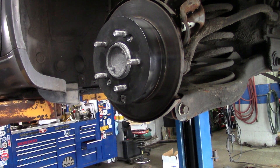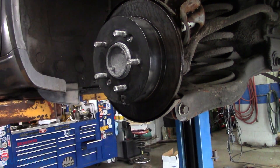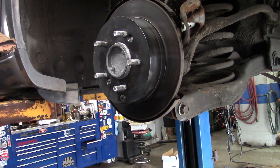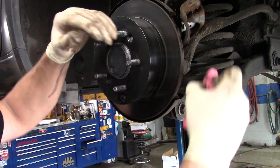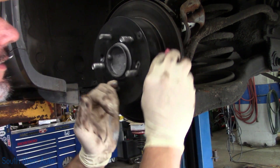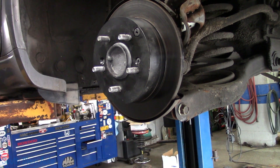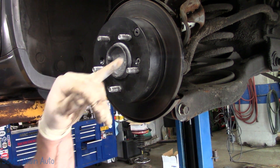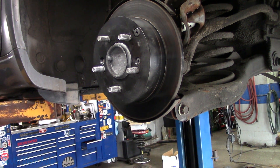You actually have to kind of burnish in your parking brake shoes just like you would a regular set of brake pads or brake shoes. What my habit is to usually do is get the car going, set the cruise at about 40, and then I just cycle the parking brake on and off — lightly, obviously. I don't do any Ken Block stuff. I'm going to wipe the rotor off, make sure it's clean, and then stick his pads back on. Drive down 40 miles an hour, do a couple cycles with the parking brake, make sure they're seated and burnished. In some cases after a couple weeks of having a customer drive, I'll stop back in and readjust the parking brake shoes — usually they're good at that point for a long time.